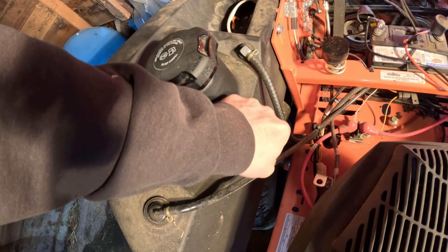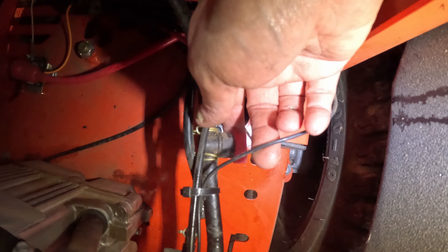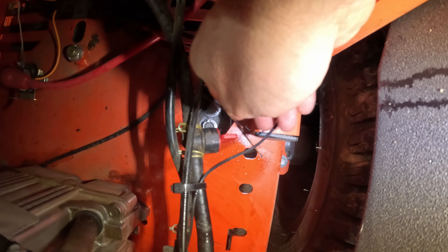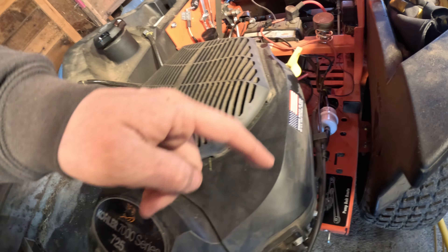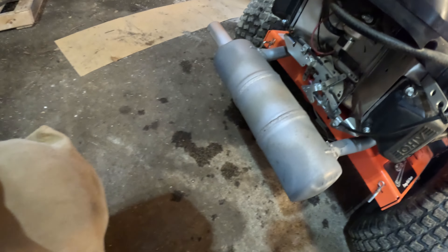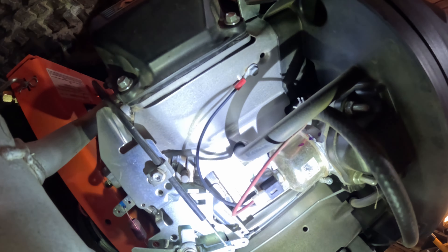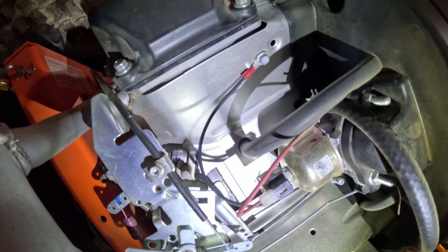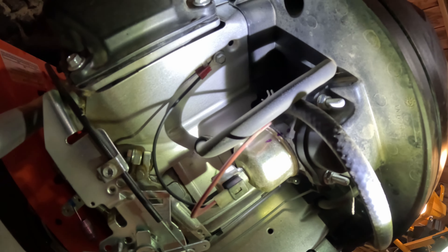These fuel lines — I've seen them get loose and get broken. Check your fuel lines. While you're investigating your fuel lines, if you've got a fuel petcock in line, make sure it's not closed — make sure that's open. This fuel filter here gets clogged up really bad — maybe you need a new fuel filter. What's going on right here is this carburetor is full of old, nasty, gross fuel. If you drain it out, take this carb out and clean it, nine times out of ten your machine is going to start. If you're not comfortable doing that, no big deal — call up your dealer or a lawnmower shop and get the thing fixed.